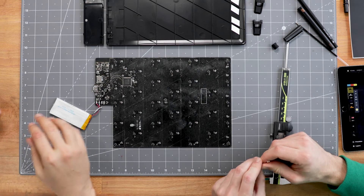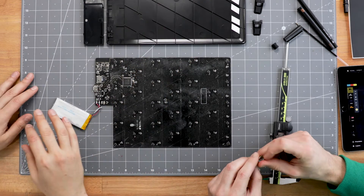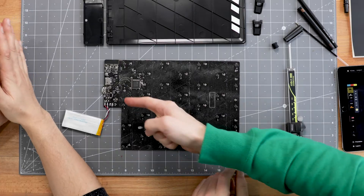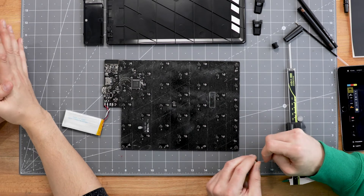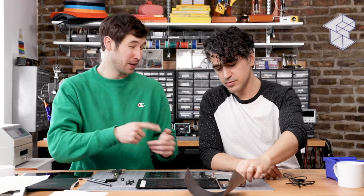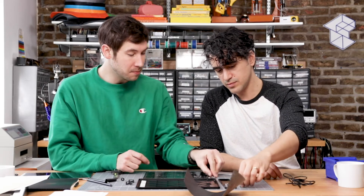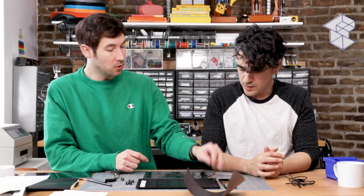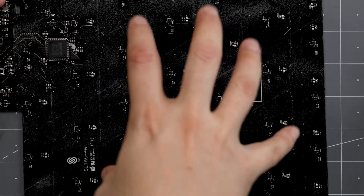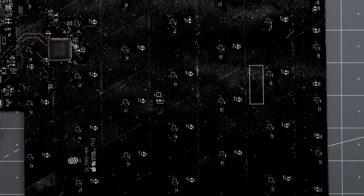We imagined that PCB was glued directly into this tray — it was not necessarily glued, it was taped with a giant pile of adhesive. We noticed there was an SD card on the side. We think maybe that's how they're doing the screenless mode, so it would record locally to this and then play back. Otherwise, it could just be a memory space for holding a program.